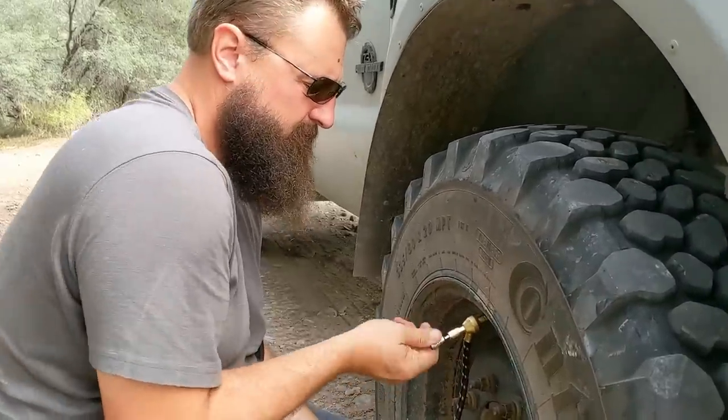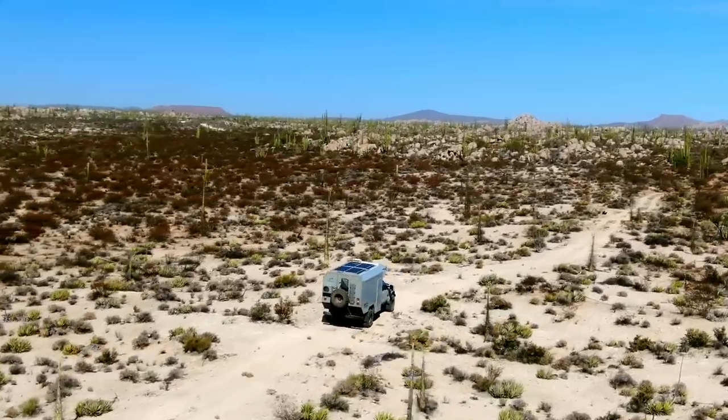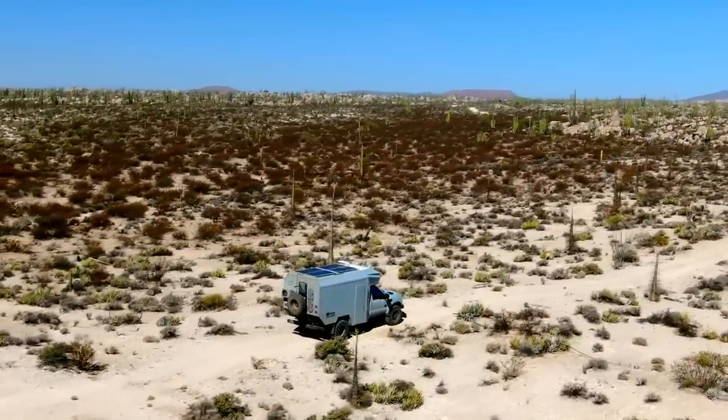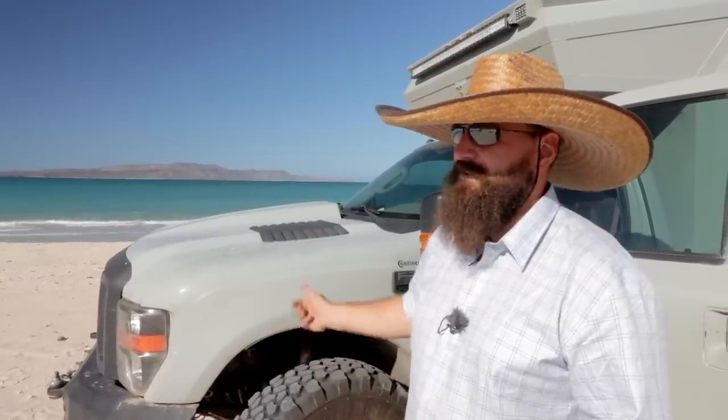And that's going to work very well for us, because if I take off one of these stems and deflate a tire to go on sand, or if we're doing a long distance of rough road where I've deflated the tire pressure, then when I put the cap back on, it learns that new pressure as its target pressure. Which is going to be really great, because if we're super low pressure and heaven forbid we pop a bead or something, it'll monitor that new lower pressure, and if there's a problem at that new lower pressure, I don't need to go through and change a bunch of settings on the controller or do anything funny. You just take the cap off while you're filling it up, it resets after 30 seconds, and then you put the cap back on and that learns its new setting. So that's one feature I really like about this.